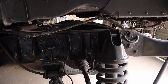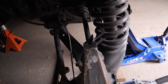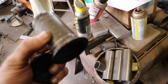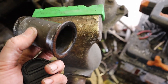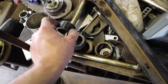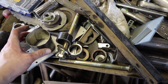We got the upper control arm out. The top ball joint didn't really want to come out very easy — took a little persuasion to break loose but it came out. I have it tied up so it's not hanging on anything. I went ahead and pressed out our old bushings. One wasn't that bad, but the other one was really rusted in place. We ended up getting those out using basically a long bolt method — took me a while to find basically the correct diameter piece to push those out. I used some spare stainless tubing I had.